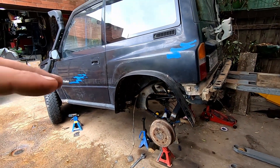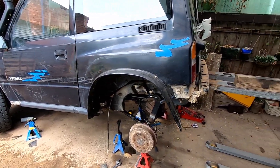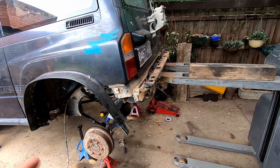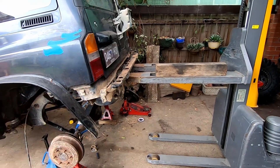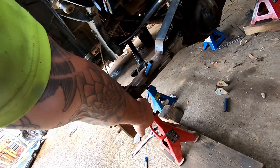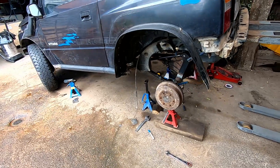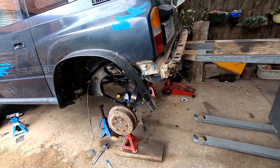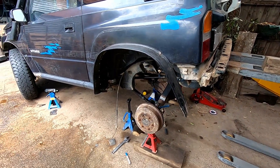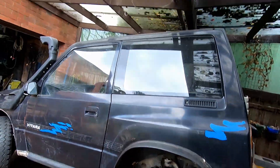All the little bits and bobs from there — it's pretty much all the hard stuff done now, which is pretty cool. With the rear full float hubs, I'm going to leave them for now because I want to drive it again. They can be done down the track — it's as simple as pulling the diff out and cutting in there. Hopefully we'll be able to fit it in the lathe, machine them off, put the full floaters on, and then we'll need to get axles made — or hopefully measure an 80 Series if someone will let me. Thanks for watching and I'll see you in the next one.